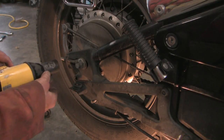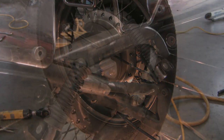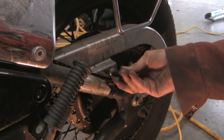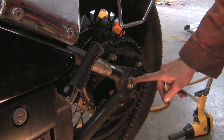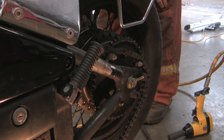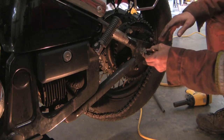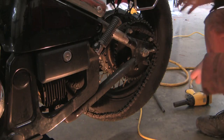Let's get this axle nut off - this is 22 millimeter. We've moved over to the left side of the vehicle now. I'm going to get the chain cover off; these are 8 millimeter, two of them. I've tightened it to the point it wasn't moving anymore, and now I just need to take a rubber mallet and tap it out from the other side. The wheel is quite a ways off the ground and doesn't want to come out, so I'm going to lower the bike down a little so it takes some weight and they should just slide out.